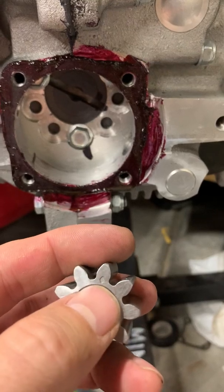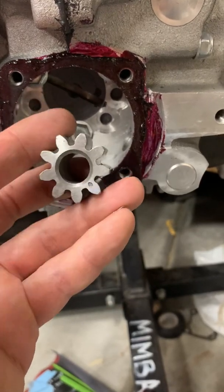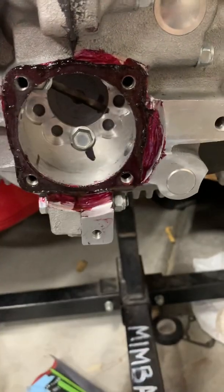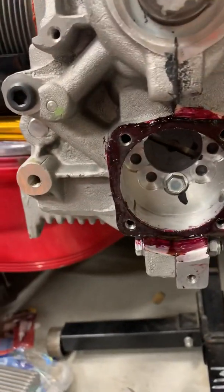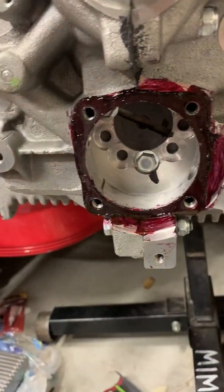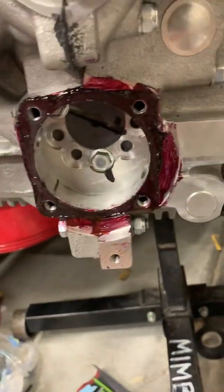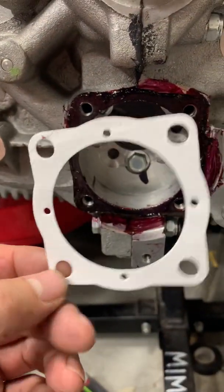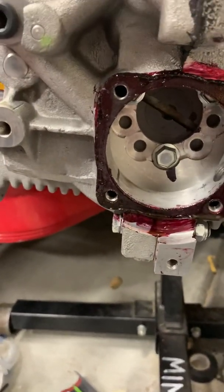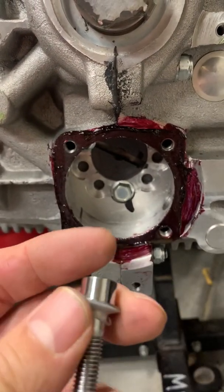Here's the other gear — you have this mark. Make sure that mark is facing forward as well. The two marks don't necessarily need to touch, but just make sure they're on the face facing you so you don't put it in the wrong way. We'll tap the oil pump in with a mallet, gently and evenly, just tapping at the center. Once that's in, we'll grab our cover, put a little sealant on this side, grab our gasket, put sealant on both sides, then bolt down the cover with our stainless bolts, the homemade milk jug nylon washer, and a wavy washer.